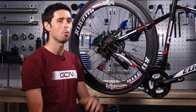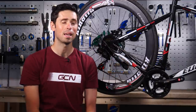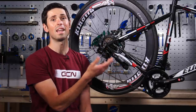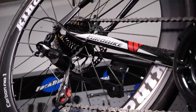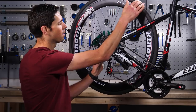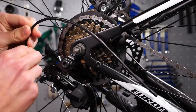While some people are fortunate enough to have electronic shifting on their bikes, mechanical or cable-operated gears are still incredibly popular. If you have a mid to low end bike, most of these cables run externally in the frame. The best way to keep them running smooth is quite simply to lubricate them every now and again. If you have externally routed cables, you don't even need any tools to do so. The first thing we're going to need to do is shift our bike into the smallest sprocket on the cassette. This will allow us to pedal the bike and manually push the rear derailleur up into the largest sprocket, creating some slack cable, which enables us to unhook the outer cable or housing from the frame guides and then move it to lubricate our cable.